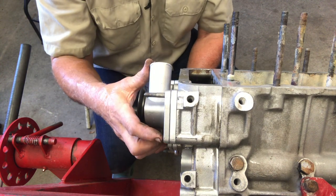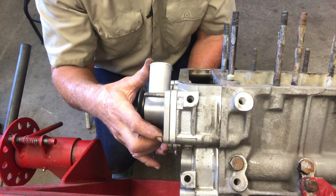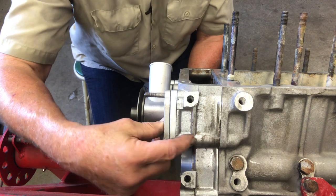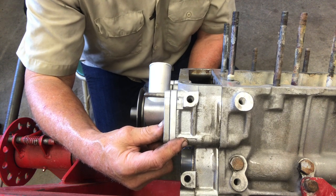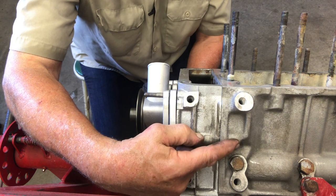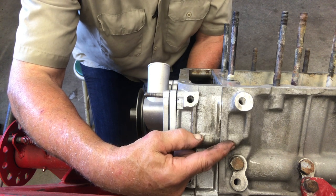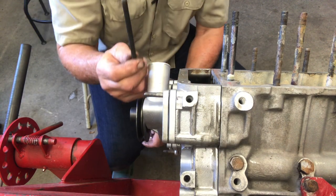So what I did is, first of all, I took a pneumatic hammer, banged on the head of the bolt, and noted that there was a little bit of movement between the bolt head and the water pump — so I knew that was free. I then took a torch and heated this portion of the water pump — not a lot of result. This hole right here through the front cover, I heated that — a little bit of response, but virtually none. Once it cooled down, after about five seconds, it stopped moving. I then went to the threaded portion right here, and that's where I got my best result. I got maybe a tenth of a turn the first time, and it stayed that way probably for ten heats with the oxyacetylene torch. Then it began to move like a quarter of a turn at a time in between heats. So after 20 plus heats, this thing eventually loosened up, and there you have it.